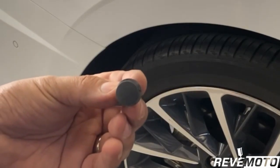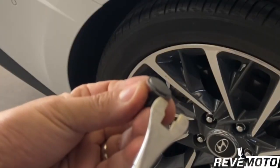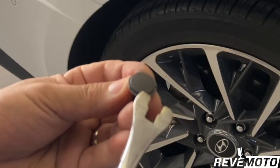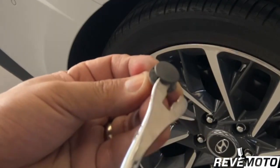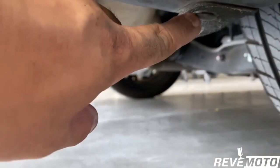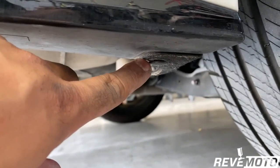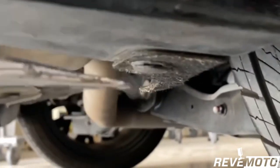So this is what a push pin looks like. And when it's depressed it looks like that — see those inserts right there. Go ahead and take that flat-head and put it in there, twist it up, and then you can release it. You guys can see right here, there's another one right there that we have to take off. Let's see if I can take it off while holding the camera.